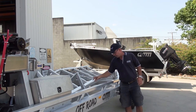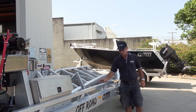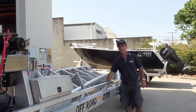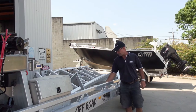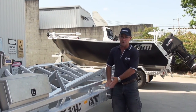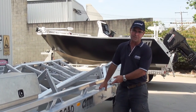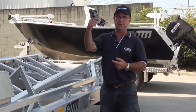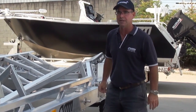This is a massive big stainless steel pin. All the pins on the trailer have been custom made out of 316 stainless steel and they serve different roles. This one here actually holds the extender bar in, and when we undo the pin the bar swings around and we use the same pin at the front to hold the whole lot together again.